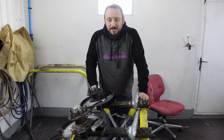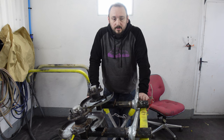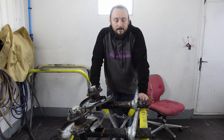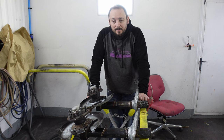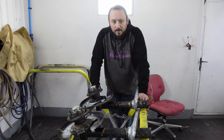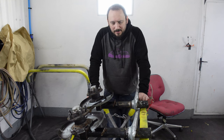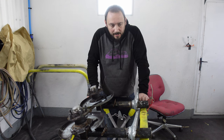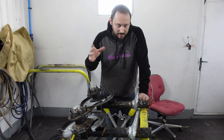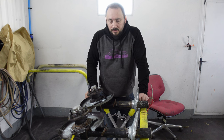The small parts are sandblasted and ready to paint. The petrol tank has been cleaned off, rust-converted where needed, and is ready to paint. I also took out the sack of lead balls that were rolling around inside the petrol tank - it was a kind of lead additive, putting lead balls in the petrol rather than actual lead in the fuel. So let's pull this apart, clean this up, grind the welds, sandblast the legs, get everything hanging up, and get some paint on these.